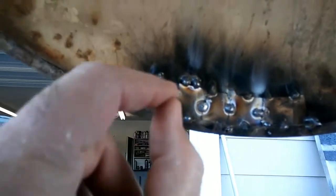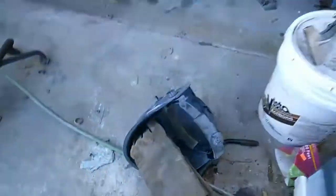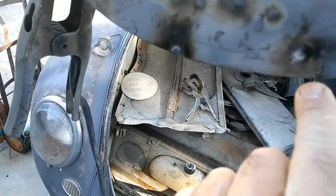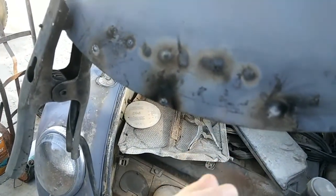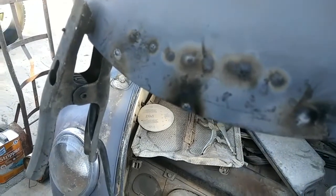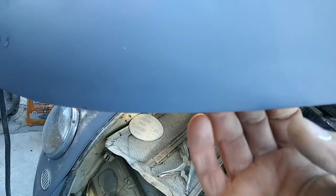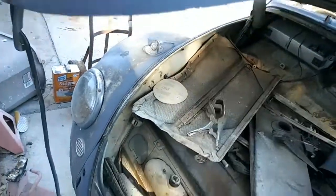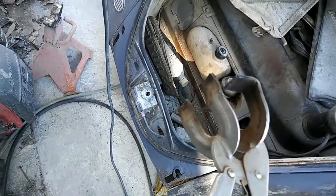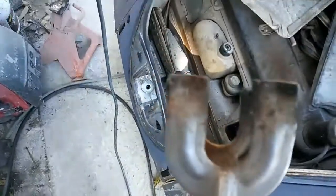Try to get as many of the pie cuts welded together as you can — you don't have to get every single one. Let me show you the outside. Mine was cracked right here. Usually there'll be a crack and it'll split right along the seam with a piece hanging down — like the Hood Historian's car if you watch his video. You fix it the same way anywhere else it's cracked, without as much pie cutting. This clamp tool here is essential — I think the full set is about ten dollars at Harbor Freight.